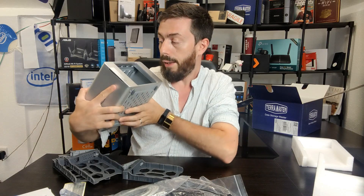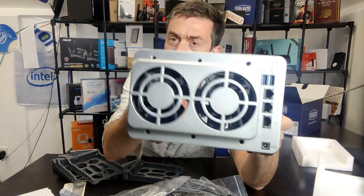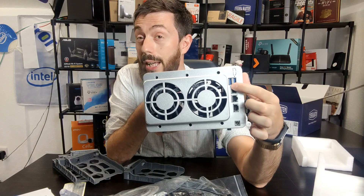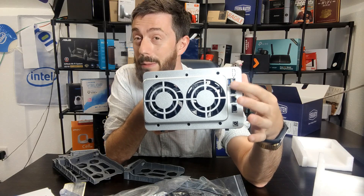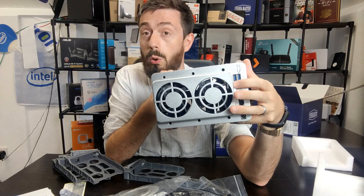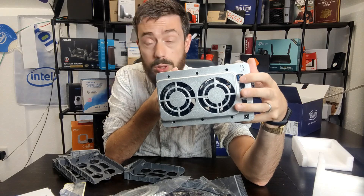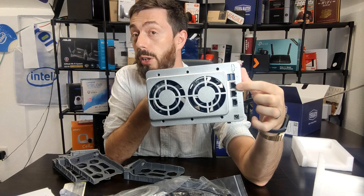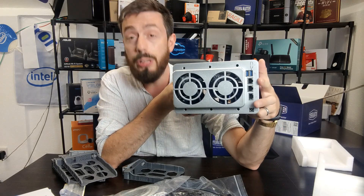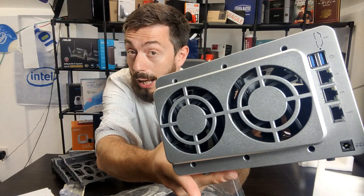There is a memory module that can be used to upgrade this device — we'll talk about that in the next video. Looking at the rear, we can see two rear fans and USB 3 ports for supported peripheral devices: external storage drives, UPS, USB printers, and heartbeat monitoring. You can make external storage or standard USB drives network-accessible within about three clicks, and you can add scheduled, differential, or synced USB backups. There are also two 1GbE LAN ports, providing 100 MB/s each, which can be link-aggregated to bring up to 2GbE with a supported switch.